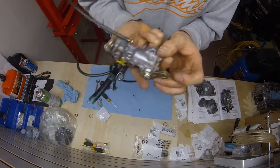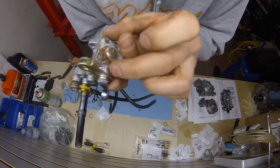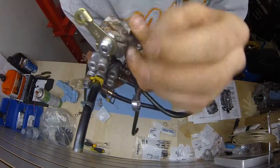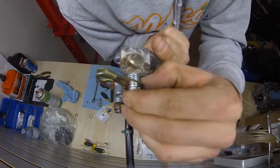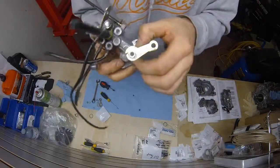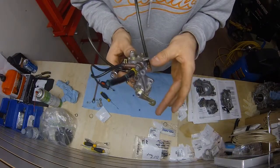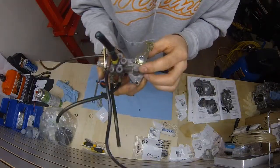Tighten that, push that up. Make sure your spring's up like that, tight against. See how that top lip, how the collar sits down there? When everything seats up, you don't want to see the collar protruding anywhere out of there. You want it tucked in inside of the spring. You know, have a nice snap. If it gets stuck halfway, something's wrong.